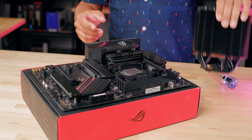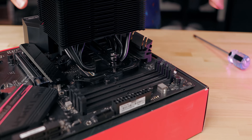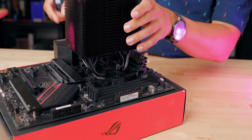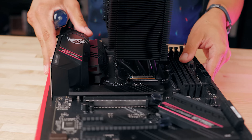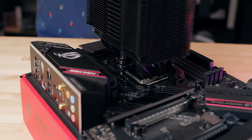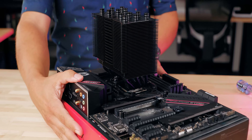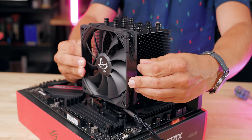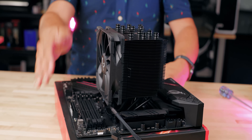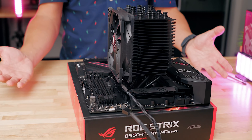With those installed, all that's left is to take the cross retention bracket that's pre-installed on the Mugen and position it over the screw holes. On one side it's straightforward. On the other side, because of that hunchback design, you have to reach directly through one of the holes, align your screwdriver, and screw it in. After that you're done. The fan mounts with two clips and it's already on — totally perfect. And as you can see, under no circumstance are any memory modules going to come into conflict with this fan. Perfect installation — good job, Scythe.